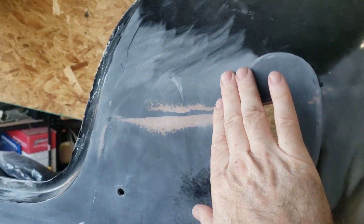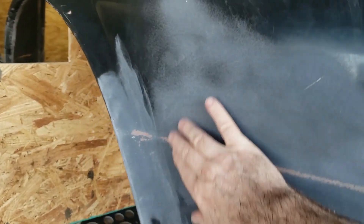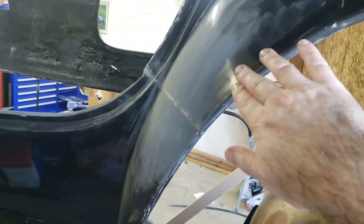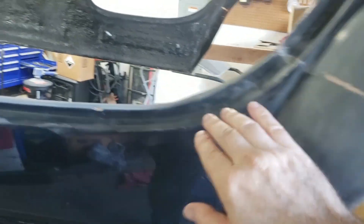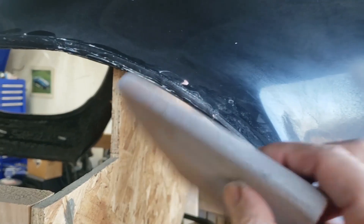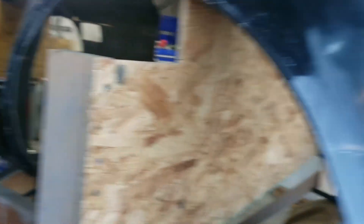This side is smoothed out — it goes down and around. There's a little bit of a ridge left there that I've got to sand a bit more. I've reached a stopping point today and I'll tell you why. On the other side that's done, and I've started doing this piece. The taco block is just a sanding block shaped like a taco — a little more flexible than my other dura blocks. I purchased it today at English Color while getting supplies and I like it very much.